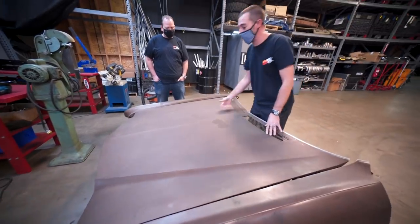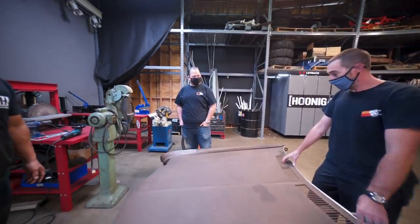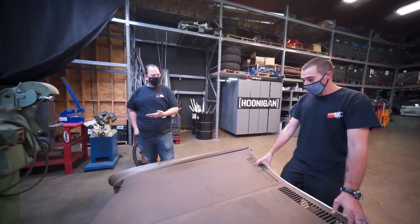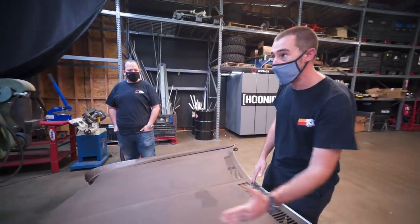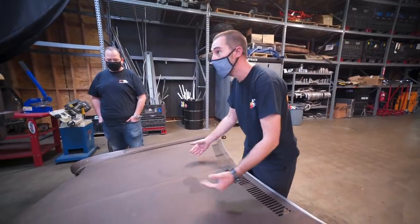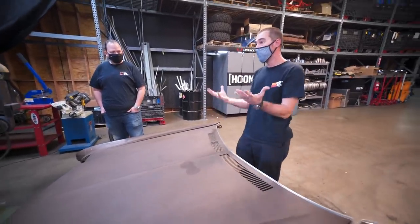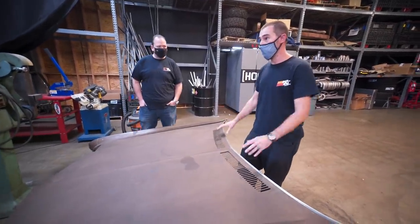We just got to figure out what kind of structure to put underneath it. The only thing I think that'd be different is that it's strong, but it's not necessarily as rigid when you're going for weight. So you might have to add some straps in there to keep the rigidity, right? It's pretty easy. We make angle iron out of carbon, and then you bond that under it, and it'll create a strong point, like a ridge, if you wanted this to be stronger. You're basically putting ribbing into it. Exactly, so you can put it across this way, you can do your own V-shape. You can almost mock up the stock steel stamped piece for the back, or you have to create that whole piece out of carbon, which is a whole other process.